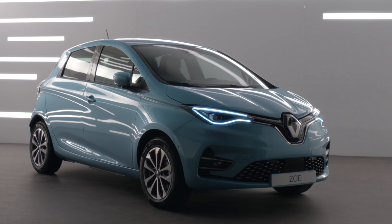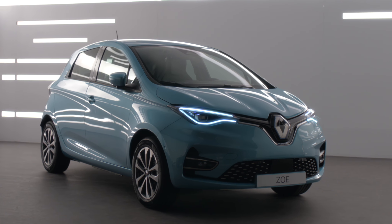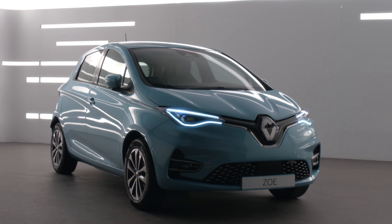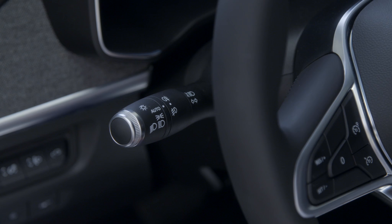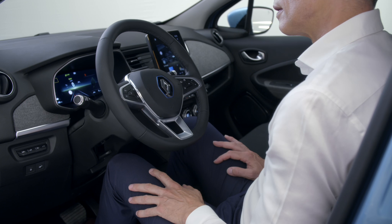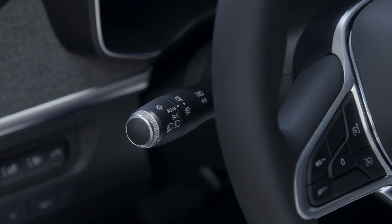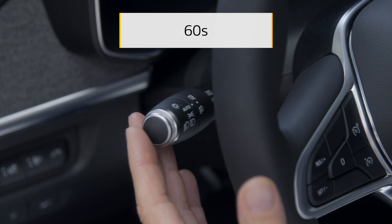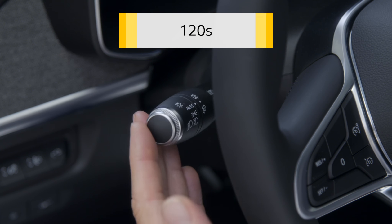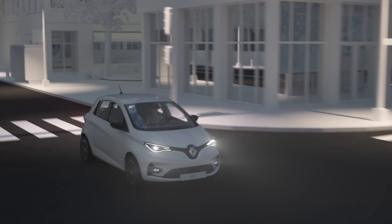Finally, the see me home lighting keeps the lights on for several seconds after you leave the vehicle. When you switch off the ignition with the ring set to auto, pull the control lever towards you once and the lights will stay on for 30 seconds. Pull twice for 60 seconds and three times for 120 seconds. This is useful for seeing your way in the dark after leaving your vehicle.